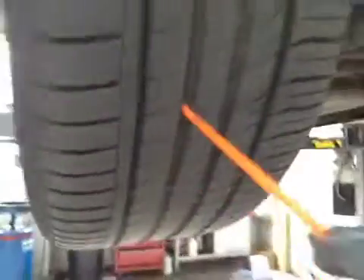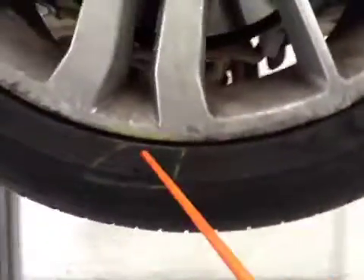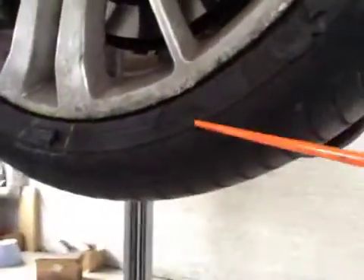This is your passenger rear tyre. The tyre has failed the MOT. The tyre tread is about 3mm, but the tyre has failed the MOT — you've got sidewall cuts here and it's actually showing cord underneath the tyre itself. So that's an MOT failure and this tyre is in red on the VHC sheet — poor condition.